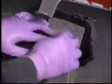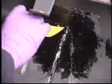Some damage may require using the traditional method of Duramix adhesive as a backside reinforcement. Prepare the damaged area and apply Duramix semi-rigid plastic repair material, part number 04240, using reinforcement patch material, part number 04904. This method offers excellent strength in difficult-to-access and high-stress areas.